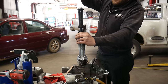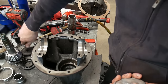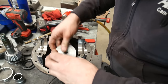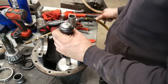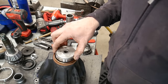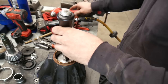Now we can put the races back into the differential housing. I had this whole differential housing in our hot tank to clean it out. I'm using my aluminum drivers on the race because I don't have a size that fits right on the top lip. The heat from the hot tank slightly expanded the whole differential housing, and since the bearing races are cold they went in with one tap. When I switched over to the outer race it did the exact same thing — it took one tap to fully seat it. If you have trouble with these and want to do the same thing, go to your local engine builder or a shop with a hot tank and see if they can run it for 20 minutes. Bring your bearing races with you and install them at the shop.